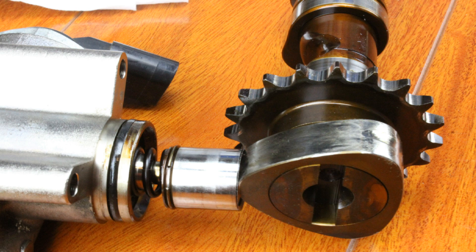So how does it work? The camshaft is driven by a chain on the exhaust cam. As the camshaft rotates around, this lobe pushes the plunger in and out of the high pressure fuel pump, and that creates the really high fuel pressure needed for direct injection.